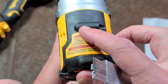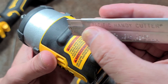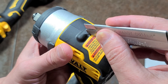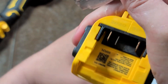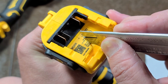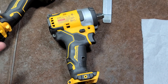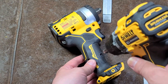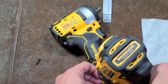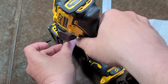When we tear these down, since it's two case halves that split apart around the gear case, we need to split the stickers. You just carefully find the seam and draw your knife across. We'll have another one down at the bottom. As opposed to attempting to peel the stickers and put them back, it's much easier just to split them — that way they're more likely to stay in place. We've got eight screws holding this together. Knock those out — all T-10s.